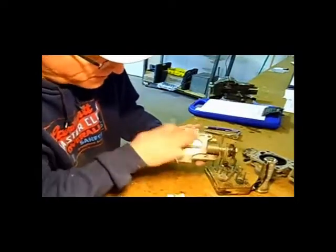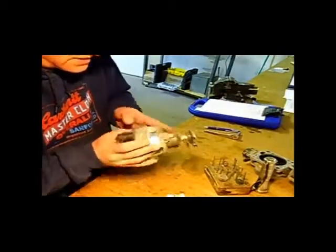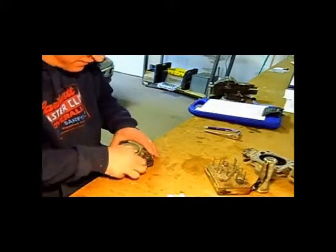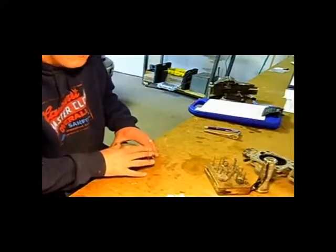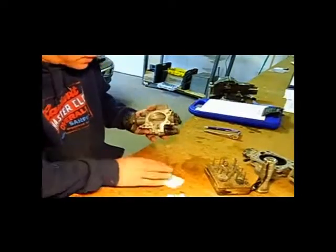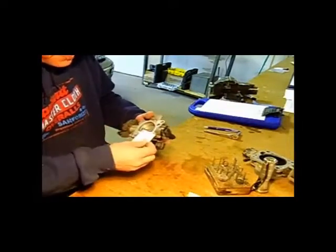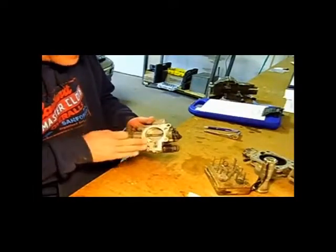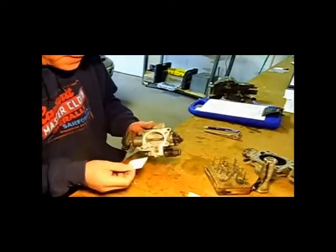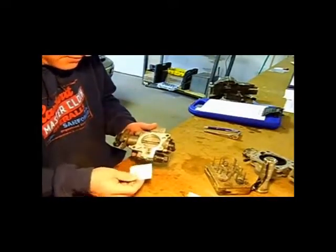But what you do is you fill it in here, then you take the rest of your business card, you lay it here like this, and you turn it upside down on the table, and you just lock it in where it's going to sit flat, and then you just let it sit there for 15-20 minutes till the JB weld hardens. Then this card will be stuck there like that. You just peel this off, just rip it off real quick. If you do it too soon, then the JB weld will tend to come out with the card. You don't want that. So make sure it sets at least 15 minutes before you attempt this, or you're going to have to go back and redo it.